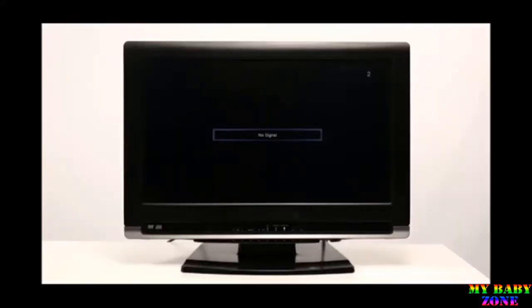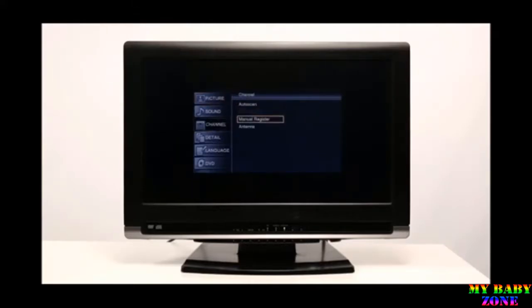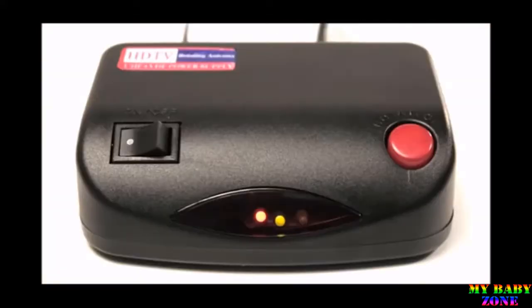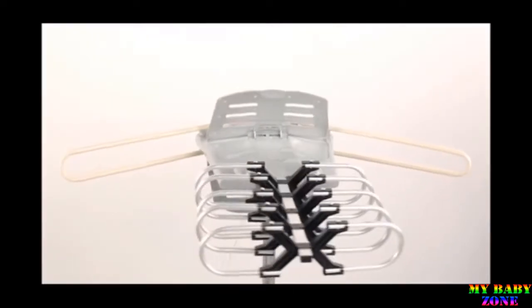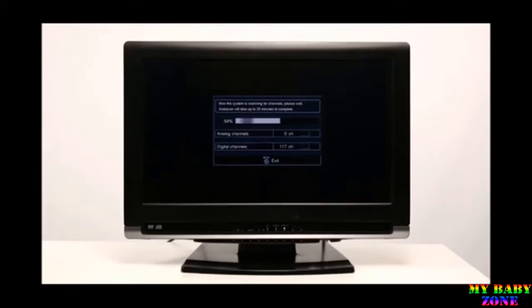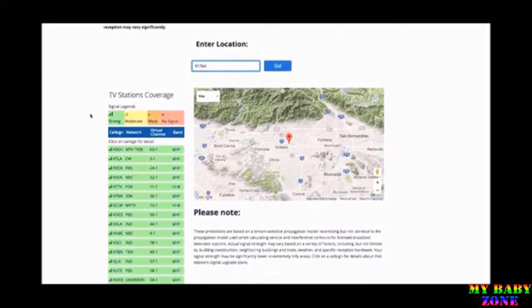The television menu will typically provide a save option to store channels already found. Each television has its own particular method for scanning to search for signals. And so if there are particular channels that are sought, begin by entering the channel into the television. Next, rotate the antenna with either the remote or the button on the power control unit until the rotor motor stops. On the television menu, begin a scanning search until it is able to pick up the channel. If the channel you are searching for is still not found, check online at fcc.gov, link in the description, to know if the channel sought is available in your area.